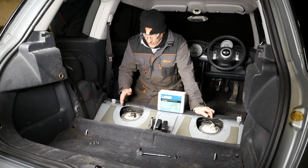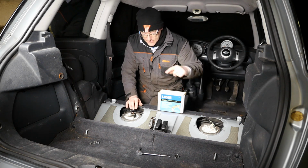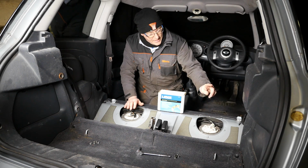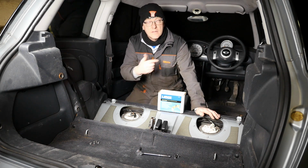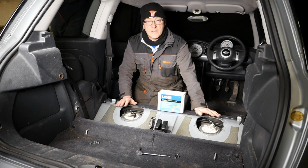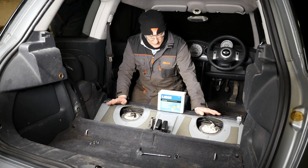Now, as far as I'm aware, this one has a fuel pump in it and also a level sensor, and it sends the fuel over to this side because it's a saddle tank, and there's also another fuel level sensor in this side, and then I believe there's a filter in there, and the fuel was then sent to the fuel rail on the engine. So it seems to be quite a complex sort of situation of the fuel coming in this side, going into this side, then going over to that side, and all that rest of it.